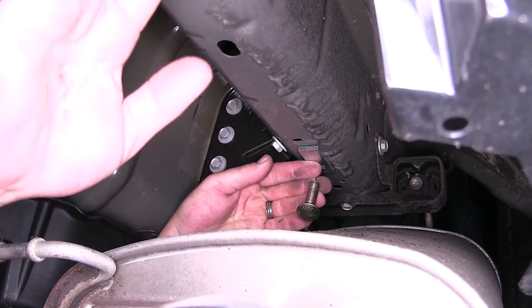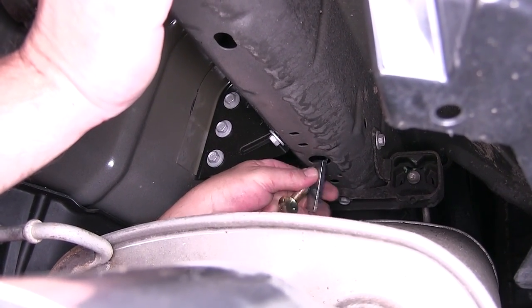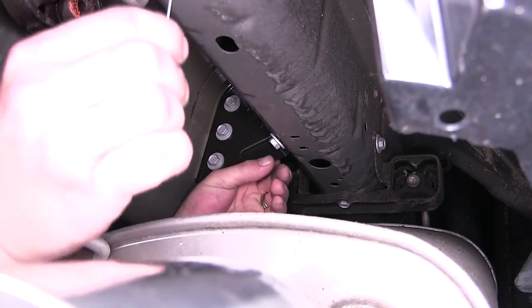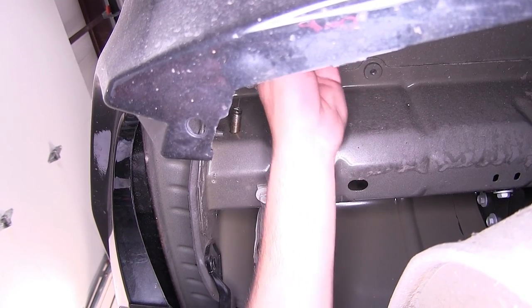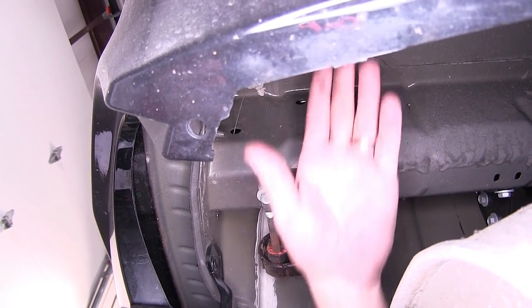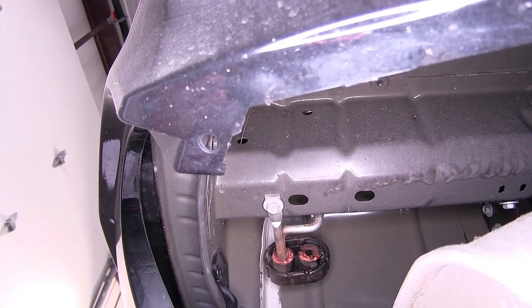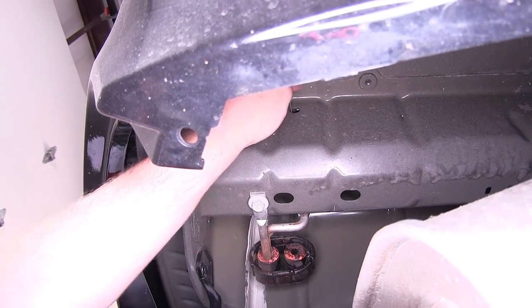Next we'll go ahead and feed them into the frame through the access hole separately. Then we'll take our pull wire and pull them all the way out to the attachment point so we know we're in position. Now I'm just going to slide it back into the frame until we get the hitch up into place. We'll leave the pull wire attached so that we can feed it through the hitch and pull it into position. With our first one done we'll repeat the same process with our second attachment point on the passenger side.